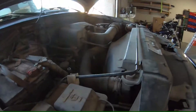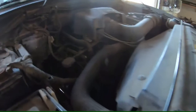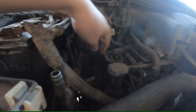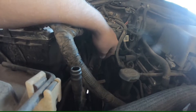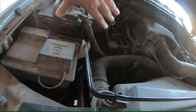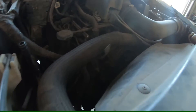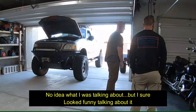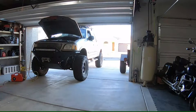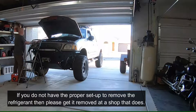This is going to be fairly interesting — we're going to have to take this off, possibly the radiator. The condenser is going to be up here under this cover somewhere. The accumulator is down here and the orifice tube should be as well. Your compressor is going to be straight down there near the battery with the clutch. We're also going to be replacing the serpentine belt while we're in here.